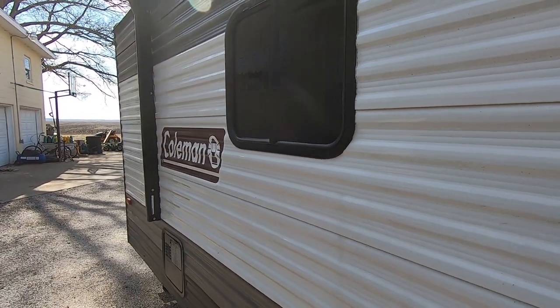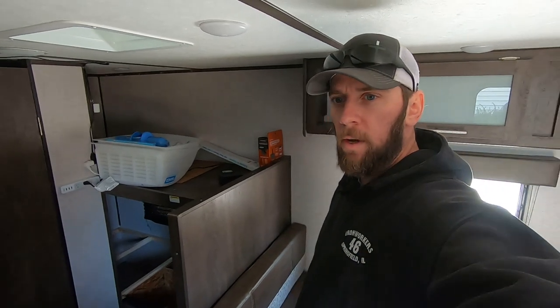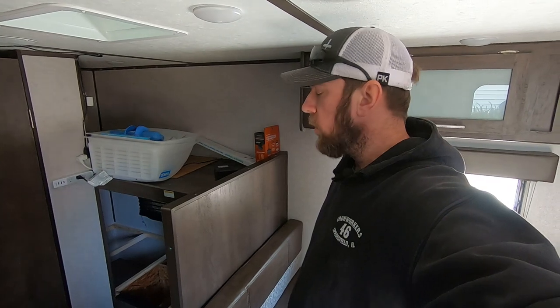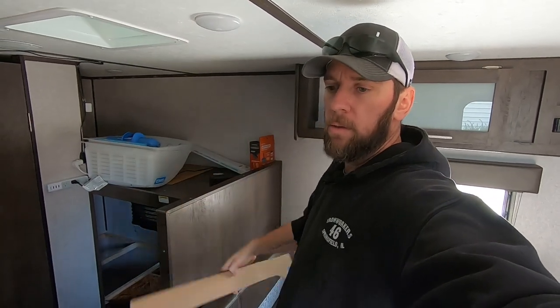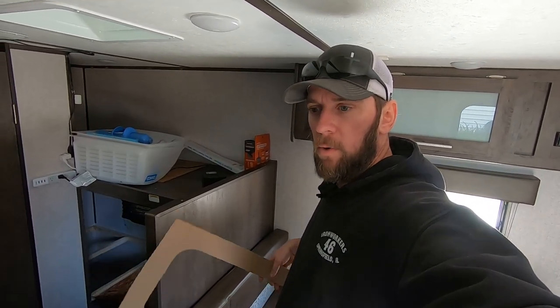Now it's time to move to the other side of the camper and work on cutting that rear access hole. We're going to start cutting the opening for the hatch we're putting under that rear bunk, starting on the inside. I've got a template made — I'll make sure it's going the right way since I marked it for direction, as the opening fit better one way than the other. We're starting on the inside and working our way out because I don't want to cut into a two-by-four from the outside and not be able to fix it.